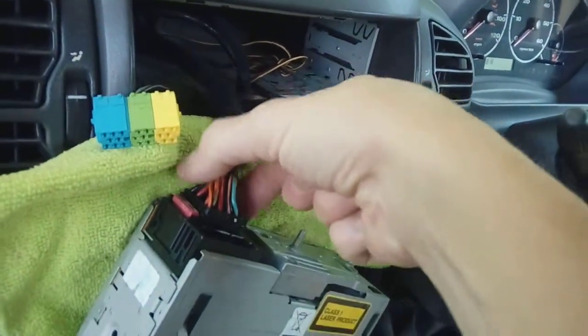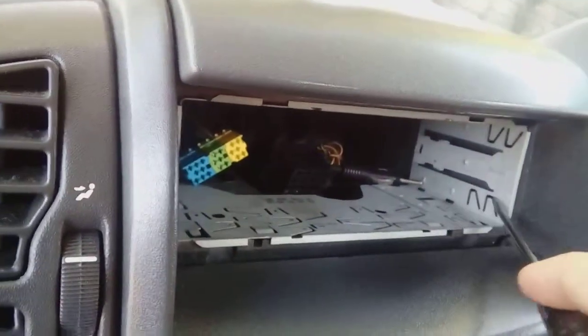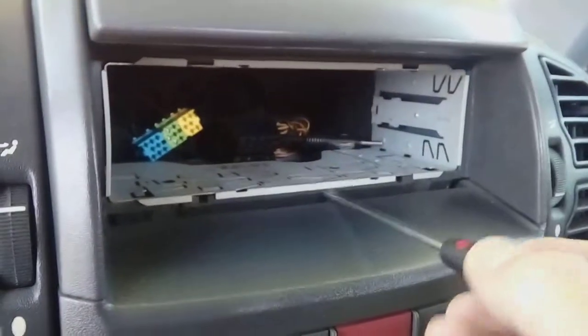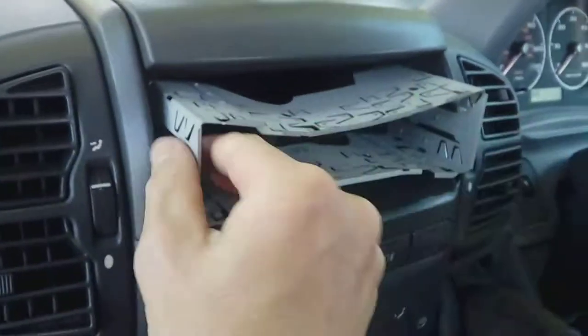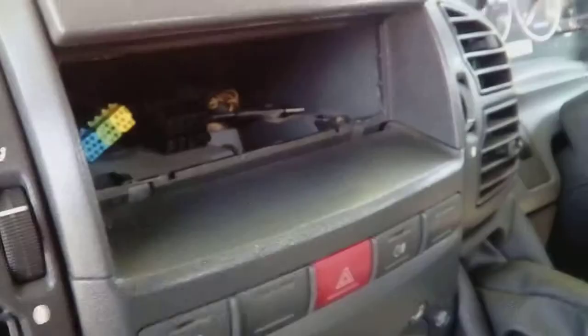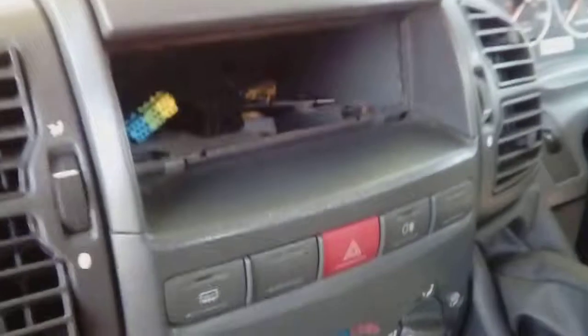For these two blocks, squeeze the pin and pull — take them both out. That leaves you with the security cage. You'll have these tabs here bent backwards, so you need to lever them up — all these ones here. Just go around, lever all the tabs up, and then you should be able to just slightly squeeze the cage together and pull. This one's been in some years — it's the original. Cage is now out. We're going to slide that back on the original radio for safekeeping — keep it all together. If you want to sell the vehicle, put the original radio back in; you'll have all the necessary parts to do it.